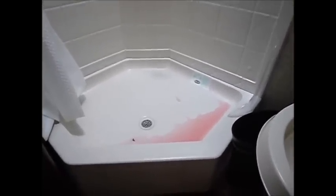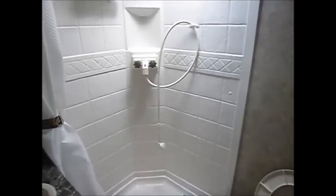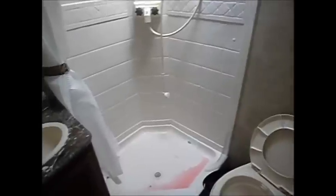You can see I got some cleaning up to do — I got RV antifreeze in the shower basin, which came from the hose on the shower. With your pump on, turn on your cold water and let it purge. Right now we're working with cold water only and that's what we're trying to get through all these lines.